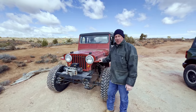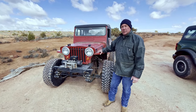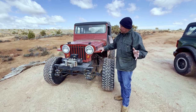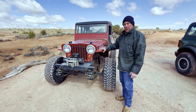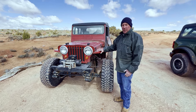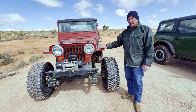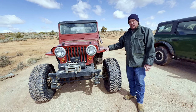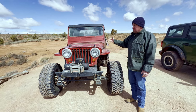This is the red Jeep. This is the other Jeep in our group today. I've talked about this Jeep before on my channel. This is the Jeep I've owned for like 20 years. It is a 1949 CJ3A Willys, whatever you want to call it. I don't care. But anyway, I've had this Jeep a long time. It has a 4.3 engine in it, which is a GM engine, SM465 transmission, a Model 18 transfer case, and Dana 44s front and rear with lockers. Also has 35 inch tires on it, running on DIY beadlocks. And this is basically my little Jeep.